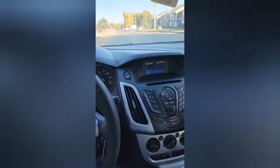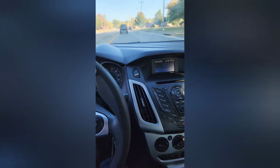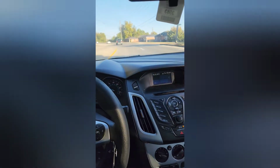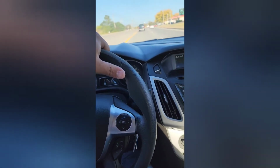I needed floor to get that TCM going. I moved some cables around. It might not be a TCM issue. I moved the cables around that plug into the TCM because it's also the PCM, and after that it fired up. So I don't think it has nothing to do with that system that's down there. At first it didn't pull nothing for the TCM. The engine code showed one related to the TCM, but the TCM itself, that module, did not pop up. So at that point in time, it was not seeing it. I moved the wires around, it started up, so now it sees it. All right, so we know what's wrong with this one, and it's the issue with 99% of Ford Focuses.